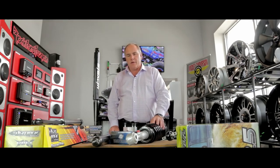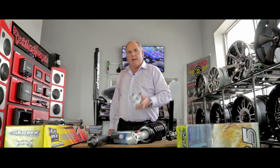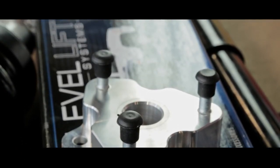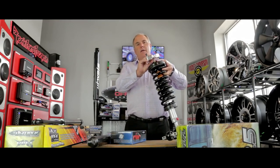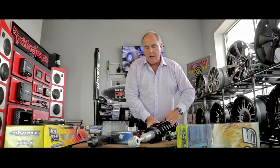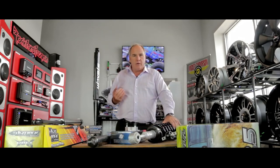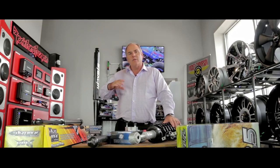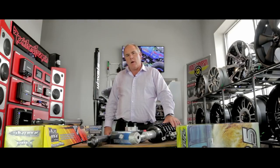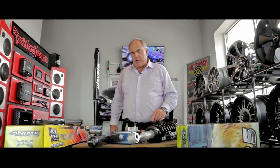This topic would apply to just about any of the North American truck brands, and even some of the Japanese brands as well. A very popular way of achieving a small lift is the leveling kit, and that's your least expensive way of entry. The leveling kit is essentially a spacer that goes on top of the factory strut, so you're not changing the shock, the damping rate, or the springs at all. It's all factory suspension set up for a much lighter wheel and tire, which can lead to problems where the wheels hit bumps and bounce without proper control — that's why we'd recommend you also consider your shocks.